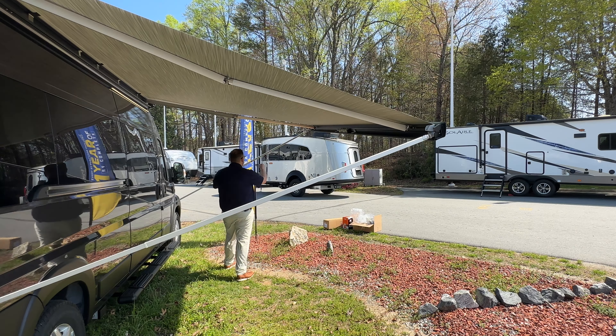This is one of my favorite things about this coach because it's kind of a hybrid — you get the best of both worlds. With the traditional E1 package Airstream has on the Interstate, that's only a battery — a humongous 12 kilowatt-hour battery that only charges off shore power or off the alternator while driving. Once you deplete that battery while dry camping in a remote area, solar isn't enough to charge it back up — the solar is just to trickle charge. So the hybrid system, which is what this is, is the way of the future: have a big battery but still have a generator. And that's what the Range Line has.